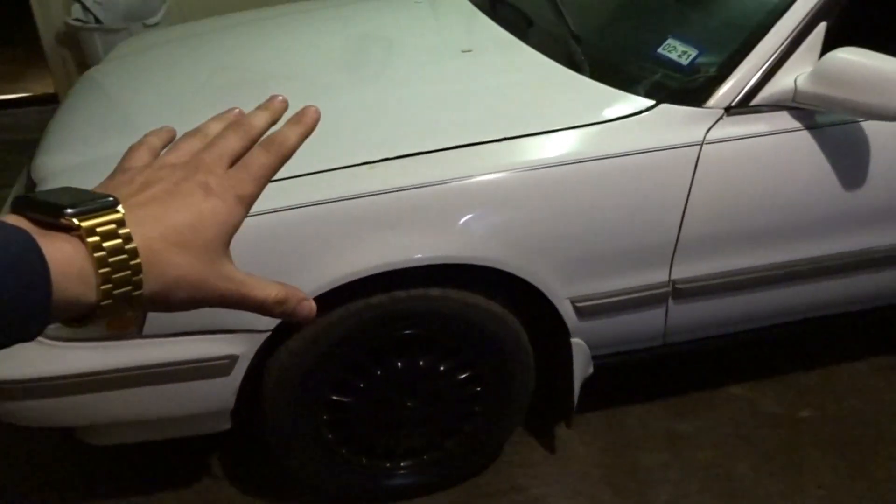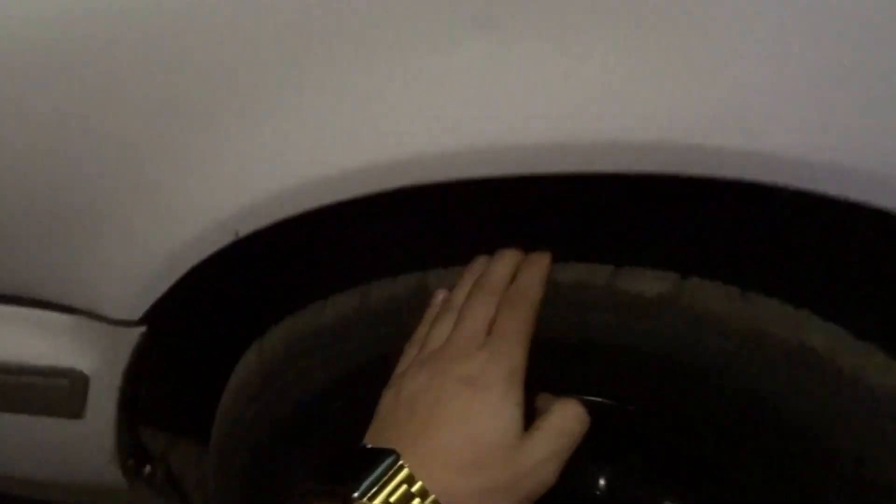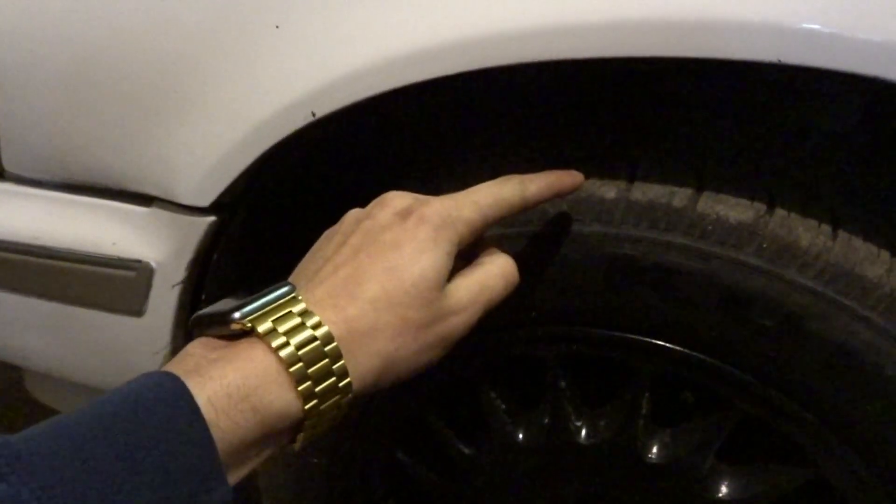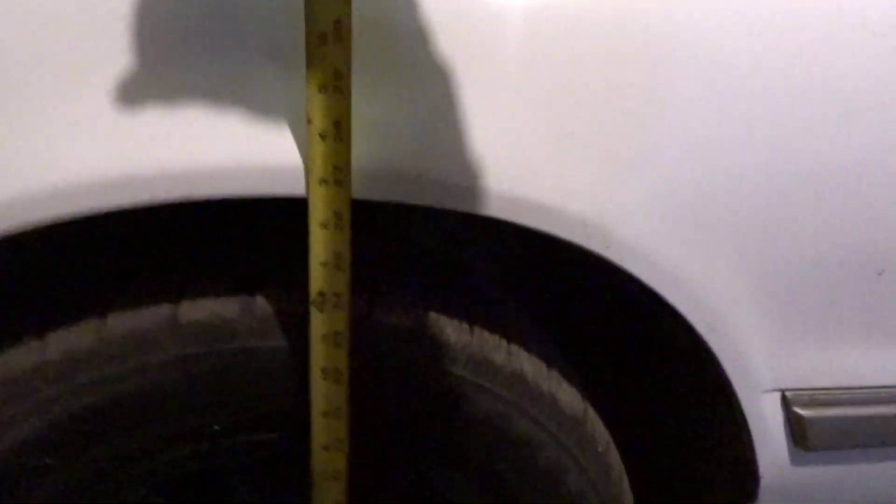These are the stock wheels with some pretty wide wall tires, so I'm not gonna go too low. As you can see in the front, I'm going to get an exact measurement — we're about four fingers in the front. I'm going to bring this down right about here, so I'll be cutting maybe an inch or two off the front. Then the back is a whole different story, it's like more than a fist, so I'm probably taking that down like three inches. So the front is about twenty-six and a half inches off the ground, and the back is about twenty-seven and three quarters.